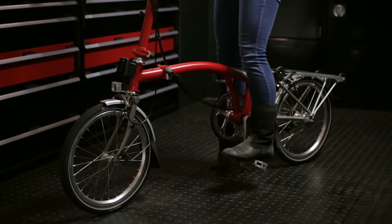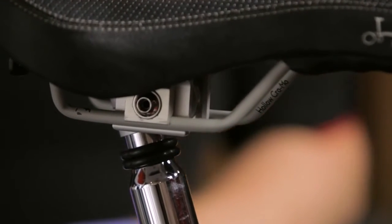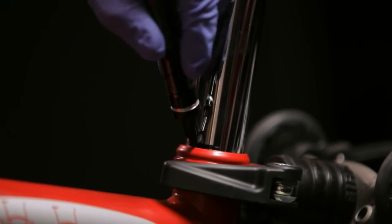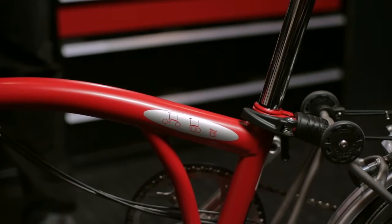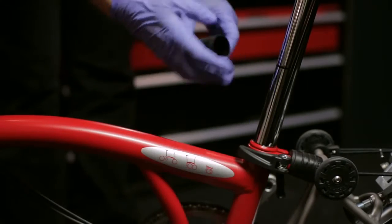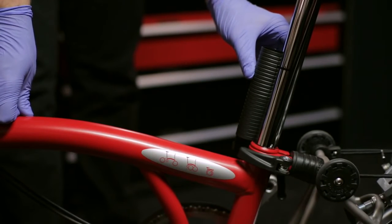Remember to use your usual cycling shoes at this stage. Set the saddle in a comfortable position — if in doubt, keep it neutrally placed. Mark the base of the post with a marker pen where it meets the seat tube. Raise the post to maximum extension and place the sleeve against the post upside down. Mark the groove adjacent to the height mark on the seat post.